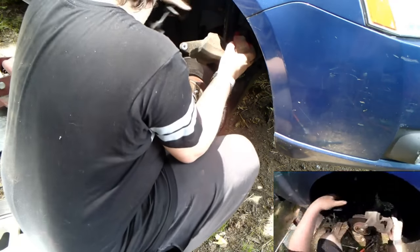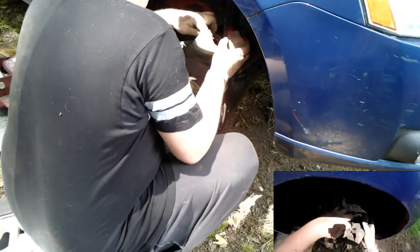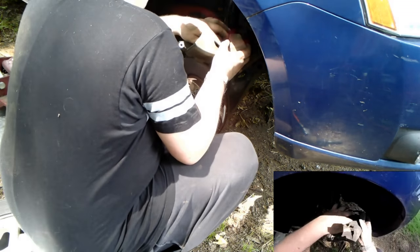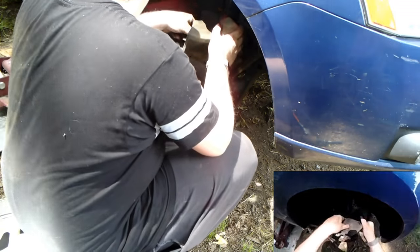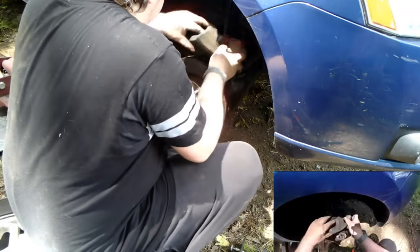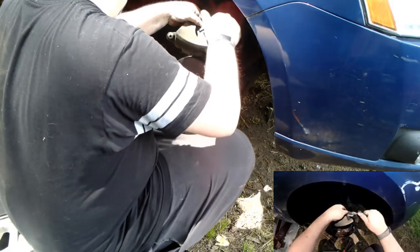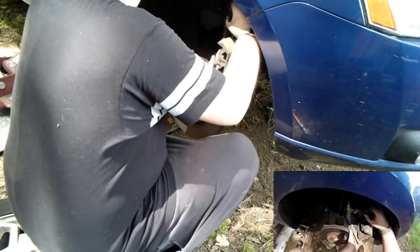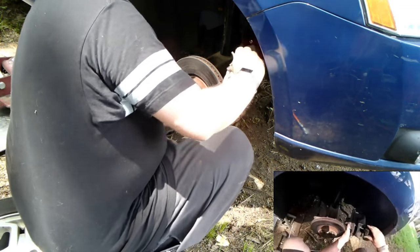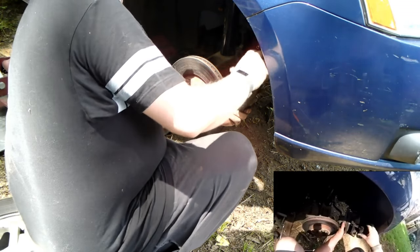So you can take a C-clamp, go around. This is crap on it. The inside pad over the piston. Take your compressor. Slowly compress now. Take as much spiral out of that hose as you can. It should go in nice and easy like it is. It shouldn't take effort at all. If it's taking effort, you're doing something wrong.